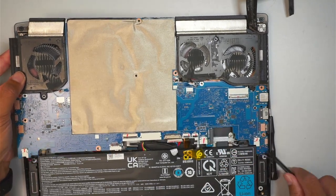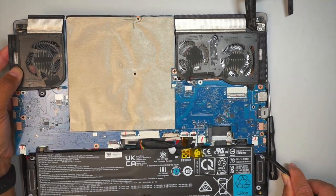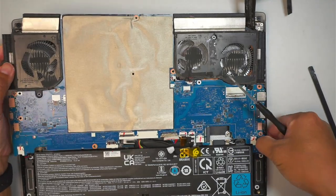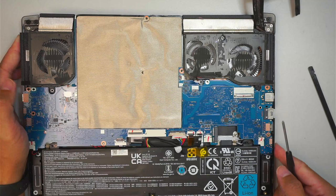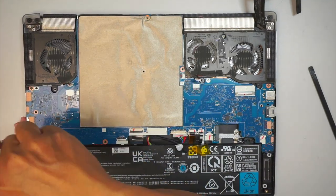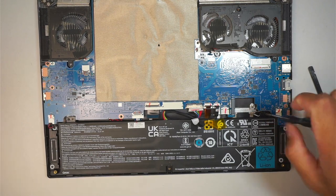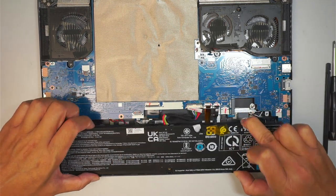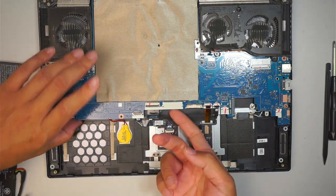The entire motherboard is coming off. I just noticed what was stuck — there's a little stuck point coming from the headphone jack. So the best approach is to remove the battery first to give it some room for the headphone jack to come off easily. Two screws are holding down the battery — lift it off and you can remove the motherboard easily.